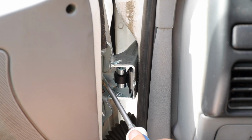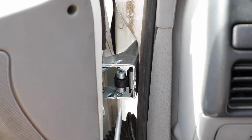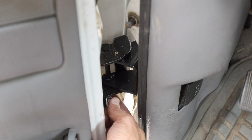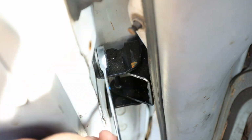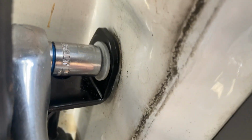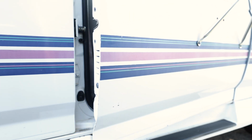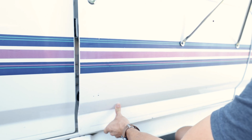Use a large screwdriver to place the upper hinge in the outward position if it's not already. Then align and reinstall the 4 bolts holding the door to the hinges. Before you tighten them down, make sure they're properly aligned with the marks. Watch very carefully when you first close the door, making sure that it doesn't catch on the quarter panel or rub against the frame. Also check the alignment with the latch pin and adjust if necessary.